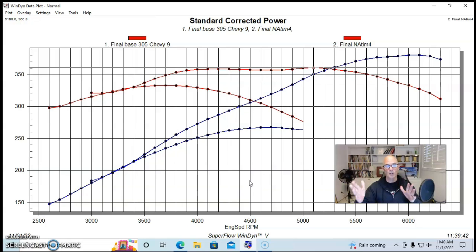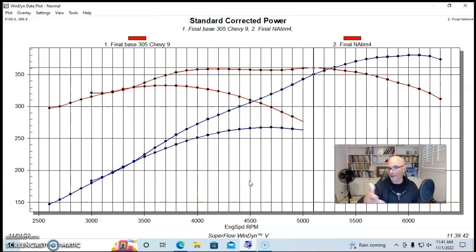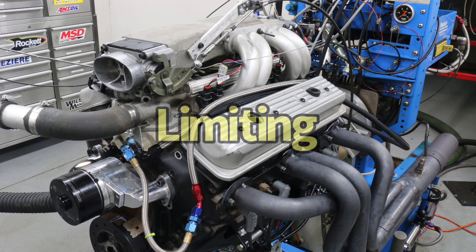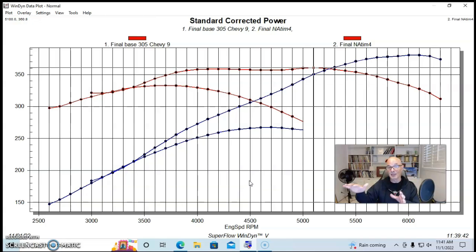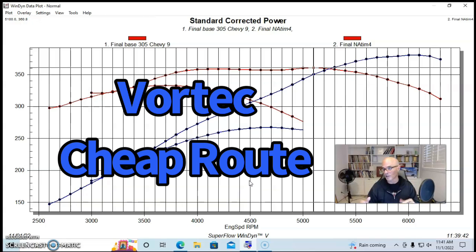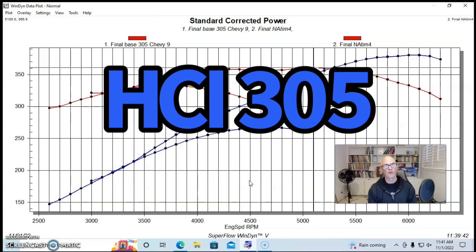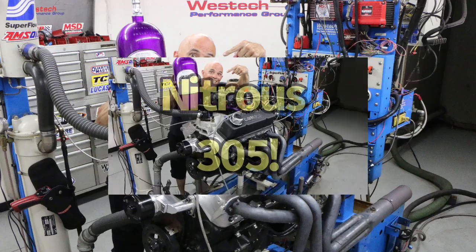I want you to look at these two curves and know there are lots of options in between. You could make 300, 310, or 320 horsepower. You could keep the tune port and just do a cam, although you won't get as big a gain since the tune port will ultimately limit power. Changing all three — heads, cam, intake — is better. If you're going the carburetor route, I'd honestly start with a Vortec-headed setup so you might not need to change the head as early. The Vortec head flows fairly well and you can get good gains from just an intake manifold and carburetor.